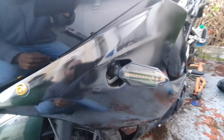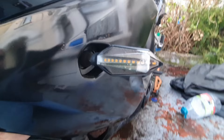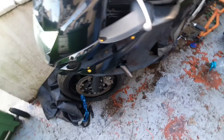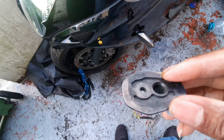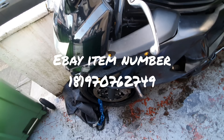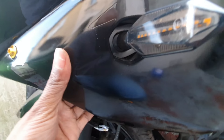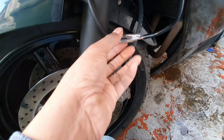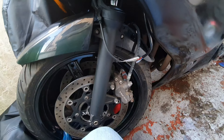So I've unplugged the original indicator - you've just got a little 13mm screw on the back and just change it. You might have to buy some spacers. These were the original spacers that I got but they won't work with these indicators, so I had to buy some aftermarket ones. If you plug the indicator on and it doesn't work, you've got a plus and a minus - all you need to do is switch around these two wires. This wire is for the side light. I've switched it around and as you can see it's still not working.